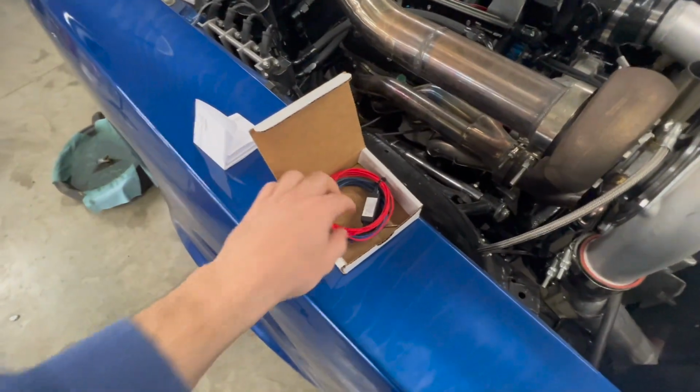So I got this trans brake saver, the input saver, so I gotta wire that up, and then I'll wire my trans brake into the computer, and then that will be good to go, and then hopefully, I'm assuming my reverse will work. I'm gonna get those two things done tomorrow night, so I'm gonna get it driving, hopefully, by the end of this weekend, because there's a car show that I wanna go to on Sunday.